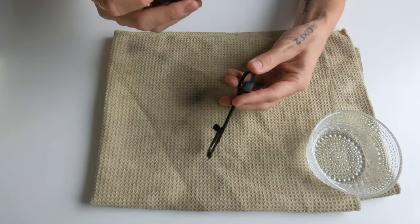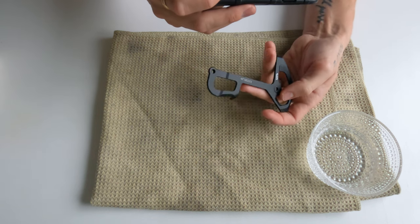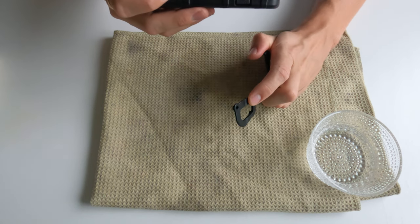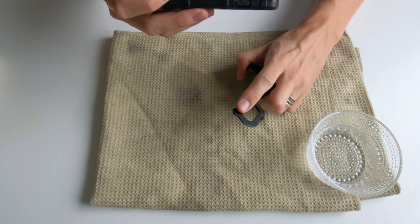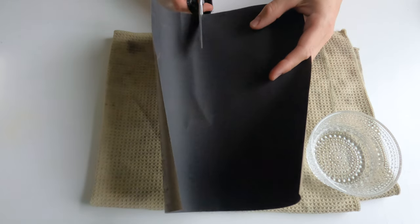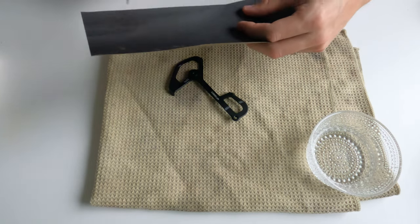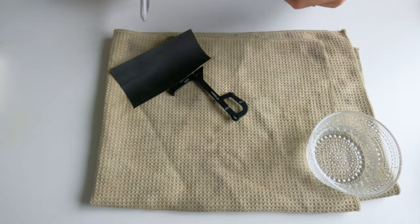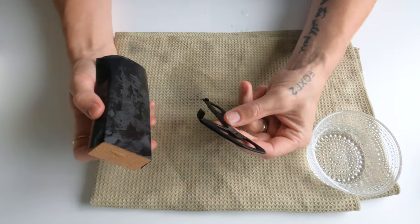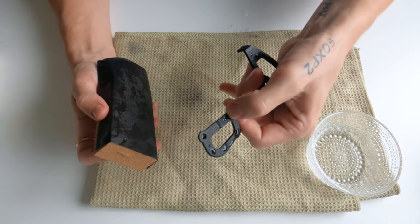So this is what we have right now — that piece. You can see there are a few ridges here. I don't want to grind those ones down. I'm probably going to start just above that little ridge, keep this area black, and then move my way up. So this is the 600 grit. I was going to start at this little ridge part — let me see what happens here.